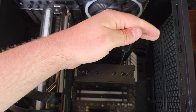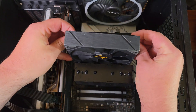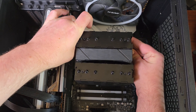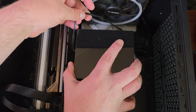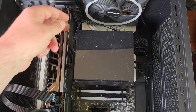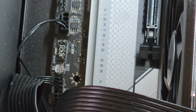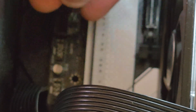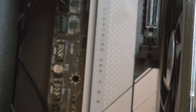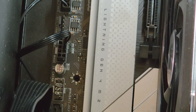Screw until it's done and that's it. For installing the fan, it's very straightforward — put clips on each side, then put this one in the middle, and repeat. This is the little display. Now I'll show you where that cable goes. You're going to see a header on the motherboard that says USB. The next port across is a USB 2 header — this is what controls the screen. Depending on your motherboard you might have more than one or two USB ports. Just plug it in and that's how you get it to work with the software you'll need to install.